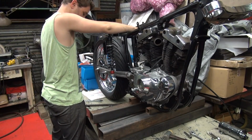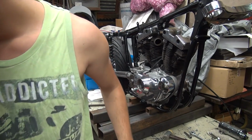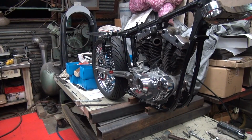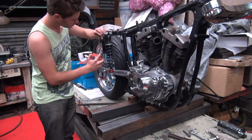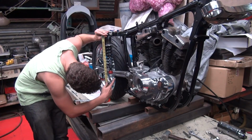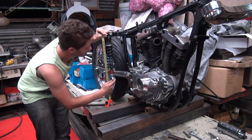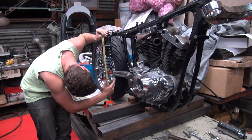I would grab the tape measure wherever it ran off to and measure it before. Or get the calipers? No, the calipers only go to 6 inches. The shock is more than 6 inches long. Oh, so you just measure the whole shock length, not the amount I added of thread? It's eye to eye length of the shock. We're looking for 14 3/8 of stock length on a Sportster. Center of the hole. No, it's 14 on the dot now. 14 and an eighth.